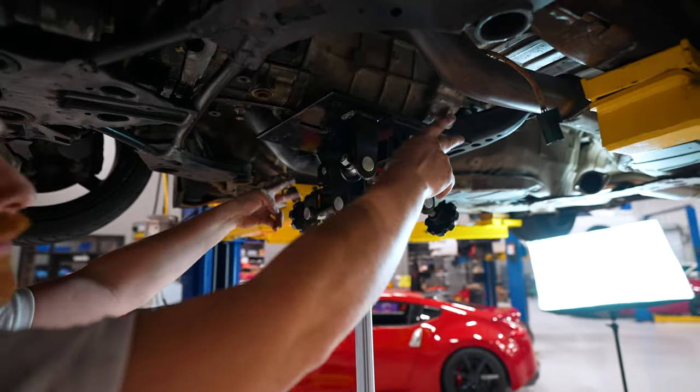So, with every kit, you get an alignment tool. So you're just going to come over behind. You're going to come up, place the friction disc on, put the alignment tool through it, and then just find that center right there. And then you're going to push it up, make sure that tool's all the way in there, and it'll sit just like that. And now our pressure plate will slide over, and the hole in the middle is big enough to go over this. So once we get everything on the pressure plate torqued down and tightened up, you just pull that plug out.